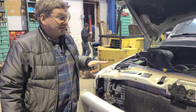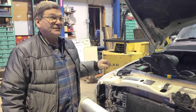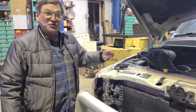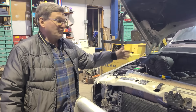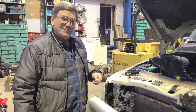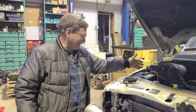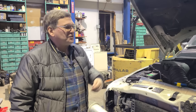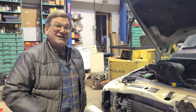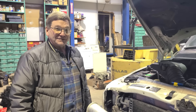For batteries, a lot of people say get a battery heater, but they're a little iffy — you're putting heat through a case. You do more if you heat the battery internally by putting a charger on it. A two-amp charger is pretty good; one amp is marginal but not bad for a really small battery; for dual batteries you could go as high as four amp. Automatic regulation is best, though they're harder to find that work right. The older ones were actually nicer than the current too-fancy ones.